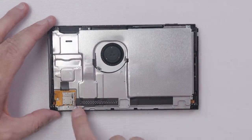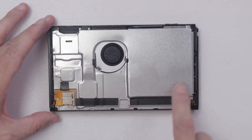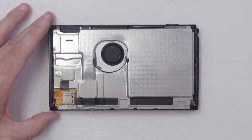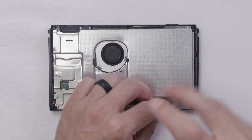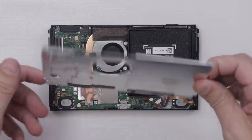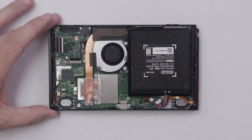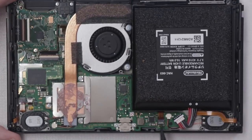So far it looks really clean inside. Got some dust here, which is normal. Fan looks good. I do need to take off this metal plate to get a real good look at the motherboard and check out the thermal paste. Got some thermal paste there. Looking at the inside, it actually all looks really, really good — super clean inside. I'm going to replace this thermal paste, then get it back together.